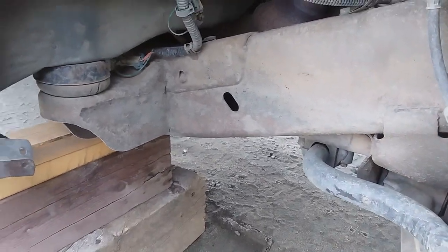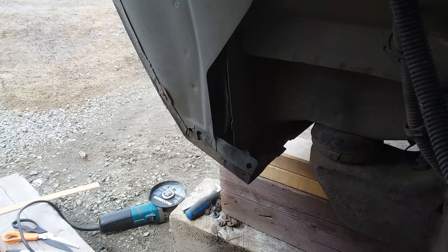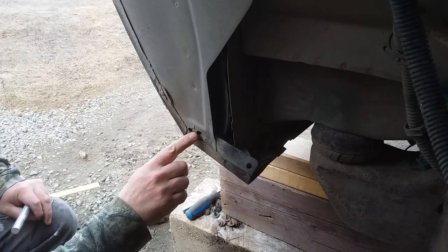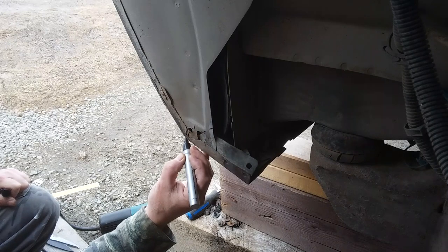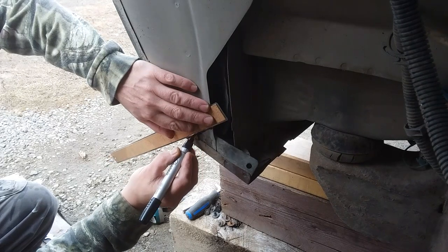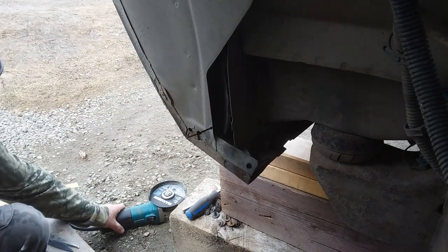Let's move on over here and see if I can get you set up a little bit on what we're doing. I hope I got a view there so you can see what's going on. What we have to do here for the wheel well mod is basically where you see this fold here - there's a bit of a line - so what we want to do is basically just follow up to the inside of that, right down to the corner. Grab a bit of a ruler here to make it look somewhat neat and a little easier to see when trying to cut it.